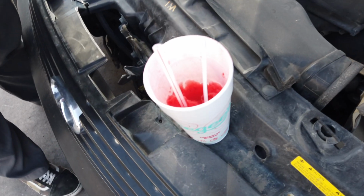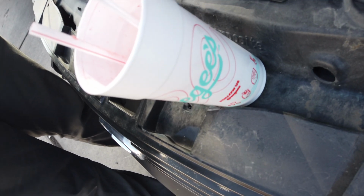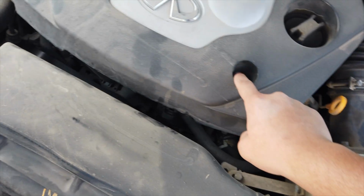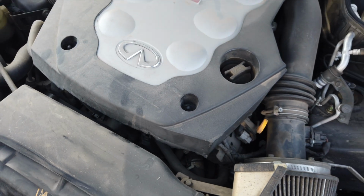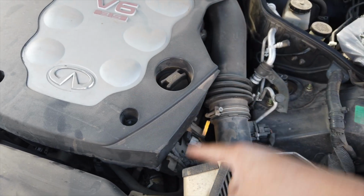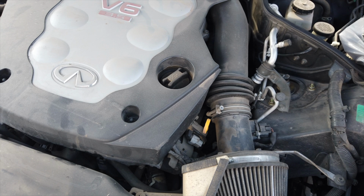Alright, so after some lunch, we got some EGs. We got EGs. Good, huh? Start on the tune-up. Got the spark plugs right there. Just gonna take these 4 bolts off, take it off, and the coils will actually be exposed. Right underneath. And then pretty much one bolt and take it out, right?